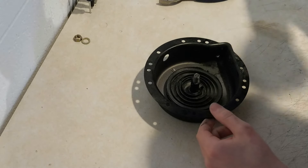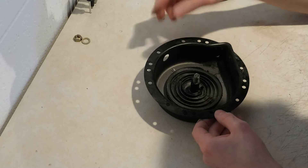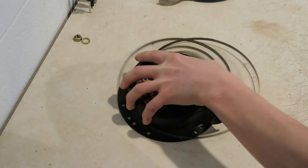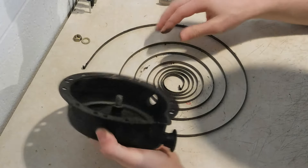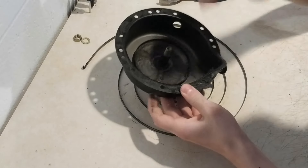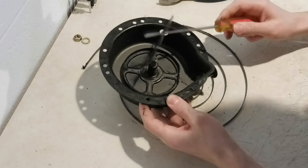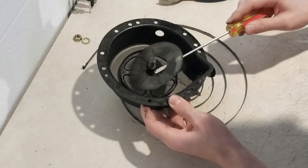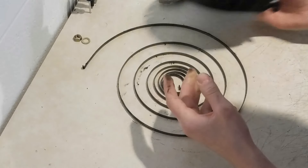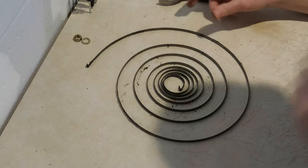You can see it's very dirty in there; the rope is very dirty. I'll probably soak it in something to help clean the junk out of the rope. Inside will be your spring — now this is still under tension, so you're going to be very careful about this. I'm going to flip it upside down, dump the spring out, and it'll just uncoil — just stand back. As you can see, dirt went flying everywhere.